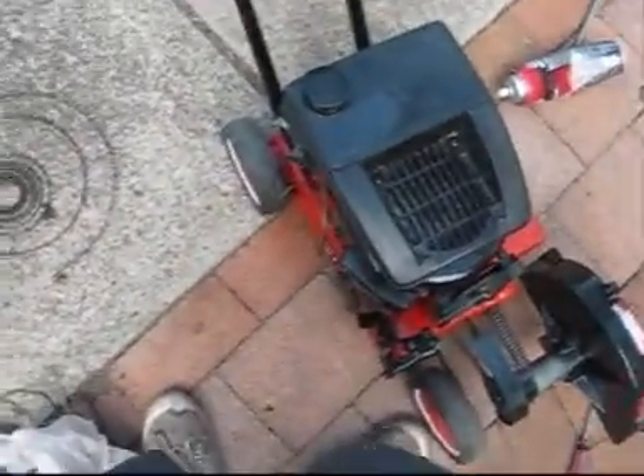I had this edger going, but for some reason it just stopped, didn't go. I still had a spark. I pulled the spark plug out and I noticed a lot of fuel was coming out — like way too much, like a huge mist was just coming out. So I've taken the carby off before I just do the regular carb clean-up.